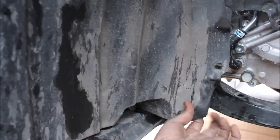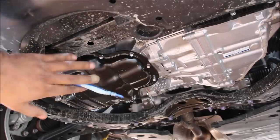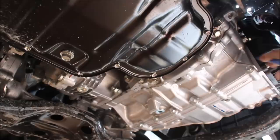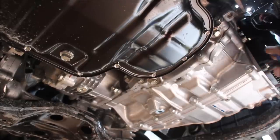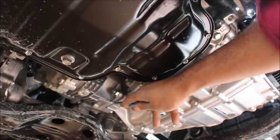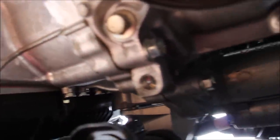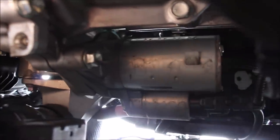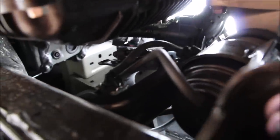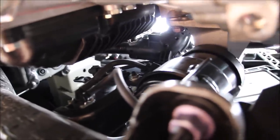The splash guard liner feels like wet cardboard but it's probably better at absorbing sound. With the engine undercover removed you can see clear access to the engine and its oil pan on this side and the transmission on the other side. On the transmission side you can see we have the valve body underneath this plastic cover, the drain plug for the transmission fluid, and the transfer case at the back for the all-wheel drive system. Beside the transmission we have easy access to the starter motor from underneath the vehicle. Beside the starter motor we have this active engine mount with its vacuum hoses and vacuum switching valve, which helps to smooth out vibrations at idle.